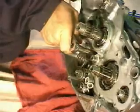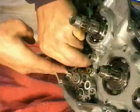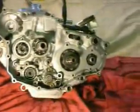12mm socket — take off the shift star. There's the gear arm locking mechanism, we're going to take that off. Spring bolt. You have to make sure you keep all the pieces in order. The shift star is off, and there's the bearing. That's everything removed on this side — don't need to take off any more. These things were removed so that you could split the case in half.